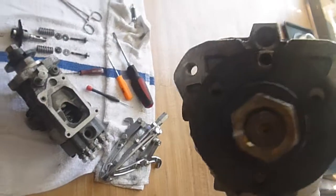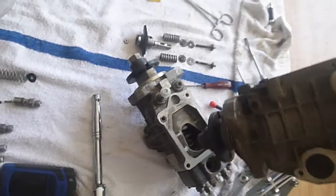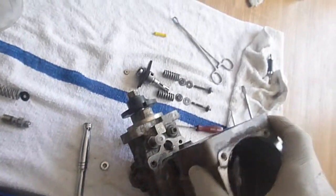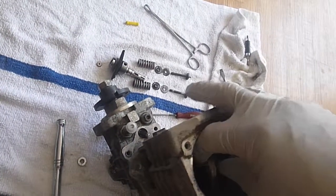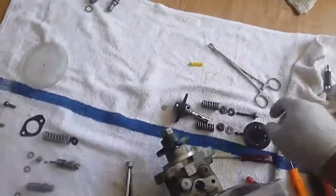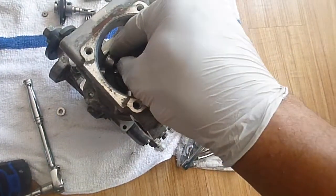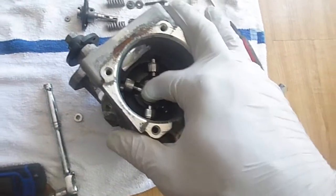You can see there's the timing gear, the sprocket hub, whatever you want to call it. But on the other side - I dropped all of the bearings out doing it that way. That's why you don't do it in the car, because in a horizontal position these rollers actually fall out. You have to put them back in but you can't do it in the car.